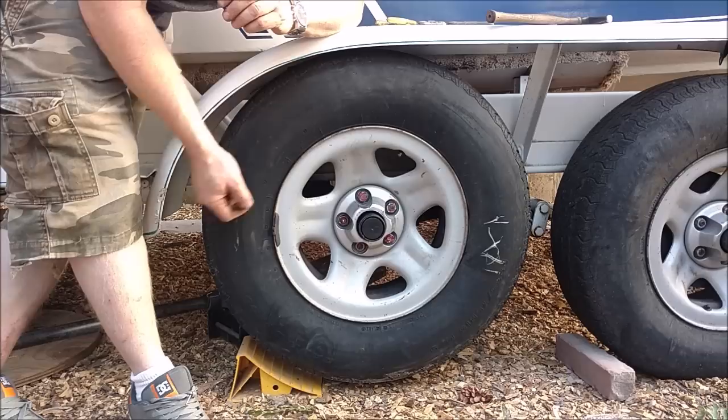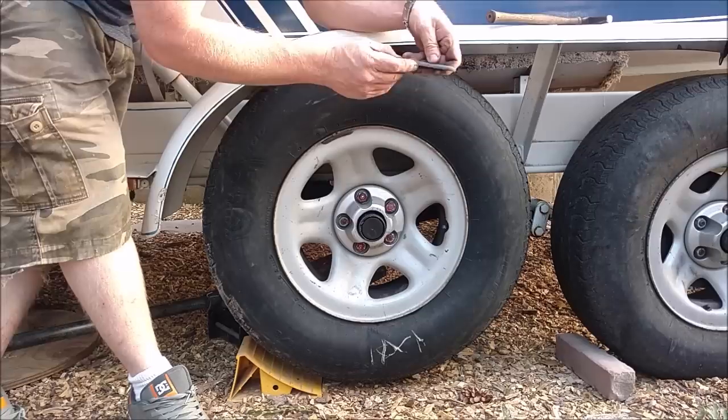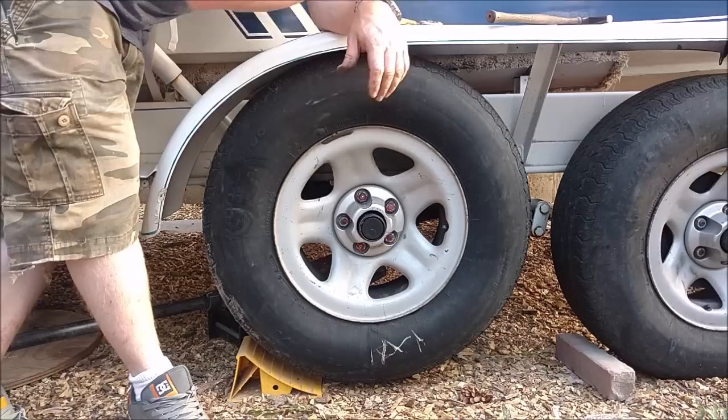Yeah, see, it continued. I pushed it that way and continued up. So this one's a little light. I got to find myself about a 1.75 or even a 2 would be about ideal. And if you can't find the exact, we have this 2.25, I can actually just cut chunks off. And tire shops actually do that on occasion. I've found ones that tire shops have put on that they've just cut off the ends to give more precise. When the tire guy is really particular and an awesome tire guy, he'll make it exact when it doesn't come in the exact weight. So let me go grab a 2 and put that on.